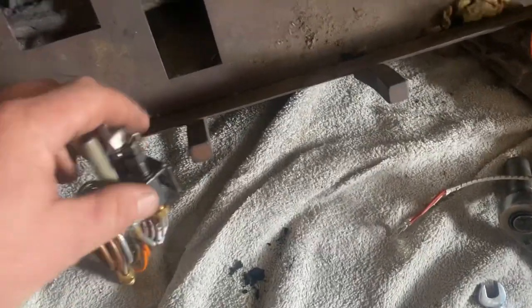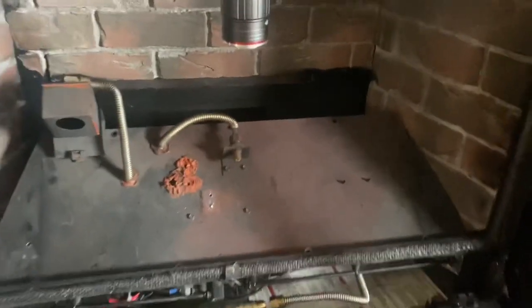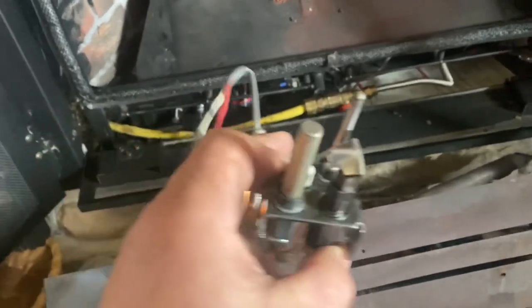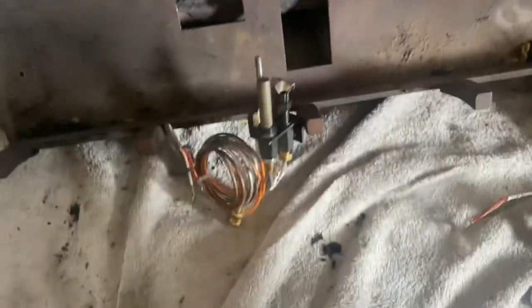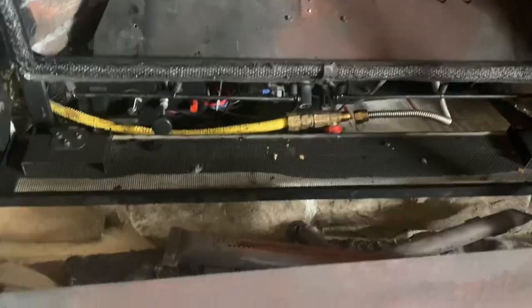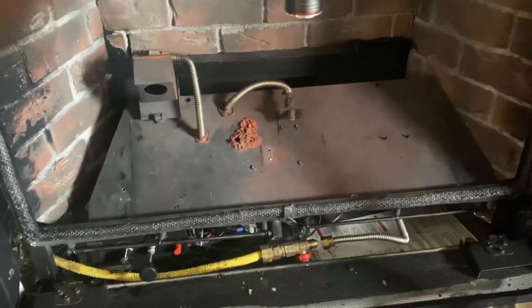This is the part that I needed. So what I think was bad was this thing here — the thermopile. But while I had this thing all torn apart, it just seemed easier to get the whole ball of wax. So it's the thermopile, the thermocouple there, this is the igniter to light the pilot, and this is the pilot. We're going to attempt to thread this all through there and hook it back up, turn the gas on and see if she makes smoke.